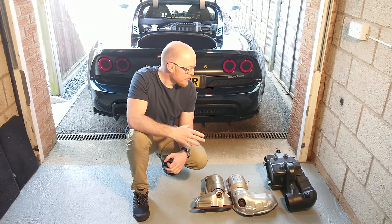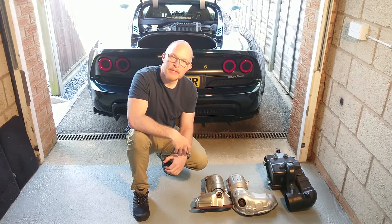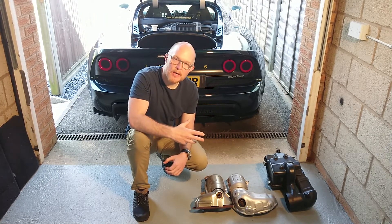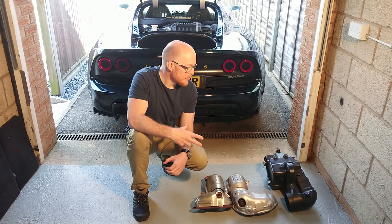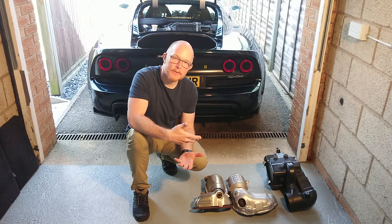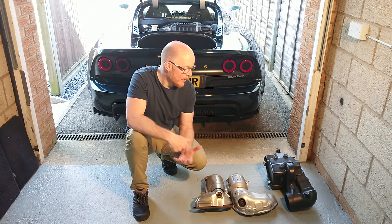The other major component that they replace is the pulley on the supercharger — they reduce the pulley size. The effect that has is it works the supercharger harder, allowing it to produce more power, and therefore again has the enhanced effect of increasing airflow and more power ultimately.